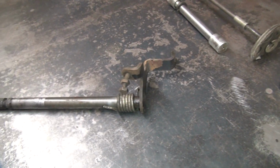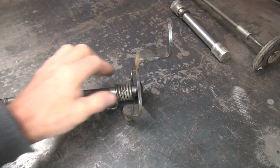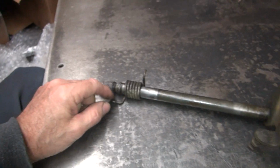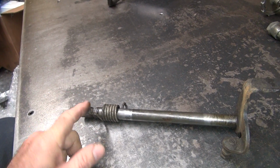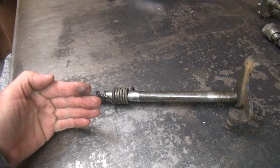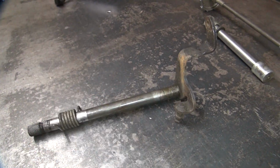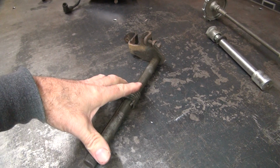There you go. This is your brake crossover. Left side pedal over here. Linkage on the right side, run the brake on the right. The spring here is supposed to be over here on this side. It goes behind the back of the primary to hold it on, and this has the 90-degree right here on it, which denotes it's off an XLCH usually. There's two variations. One just has a straight leg coming up, and the other one has a 90 to it. When you had the aluminum primary on it, you could just go straight up, not a problem. On the CH bikes, they had the tin primary on them, and you had to have this in there to hit on the back of the primary, otherwise the straight one would just eat a hole in everything. It'd pop past the gasket so it would start beating on the primary, and you'd lose some spring tension. So this is off an XLCH, this piece here. So the whole thing probably came off a CH bike. And the CH bikes are 58, I think that's the first year of a CH, through 69. They ran that design.